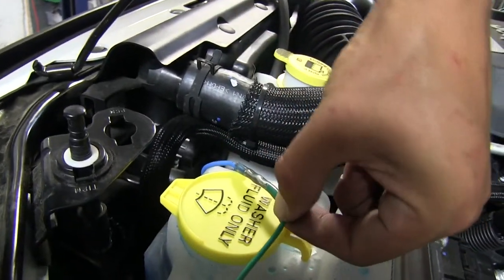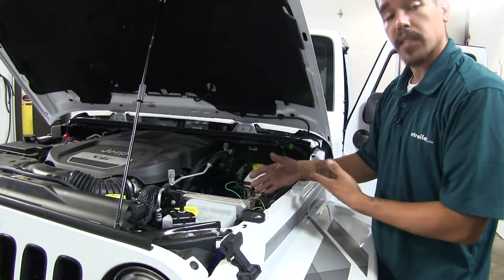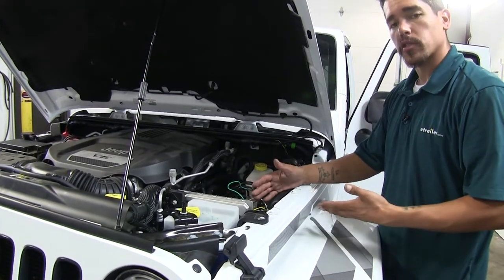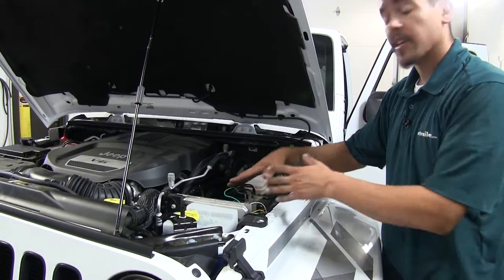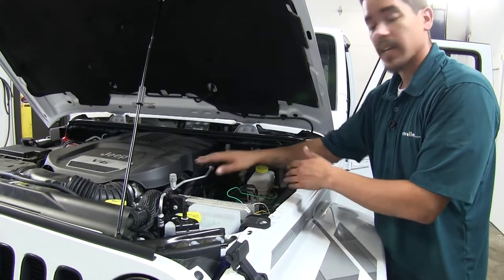This end of the blue wire is coming from the breakaway switch. With all of our wiring done, I'm going to go ahead and take some zip ties, a little bit of electrical tape, and the wire loom that they provide in our kit, and I'm going to tidy everything up and make sure it's not going to be rubbing against anything or against anything hot.